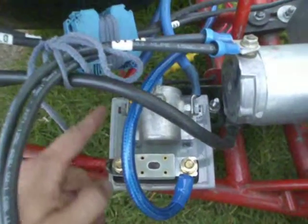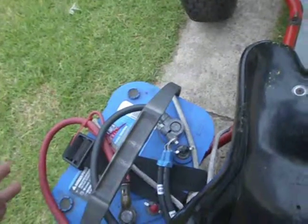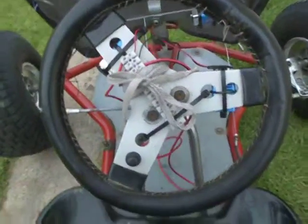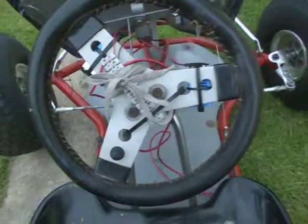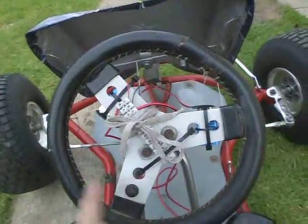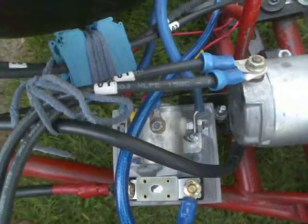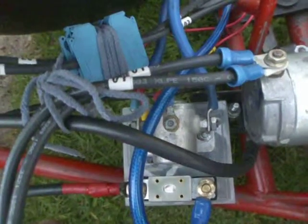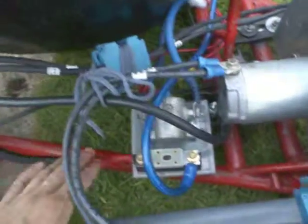What I've also done is made that particular relay activated via these two 9V batteries. The reason why I did that was I didn't want to rely on this Optima battery to do that — I wanted to have the relay activated by its own separate source. Instead of getting the power from here as I did previously, I've used two 9V batteries in series, so I get 18V, and just wired it up to the switch back to that solenoid relay there. That way, the control circuit is separate from the high-current traction circuit.